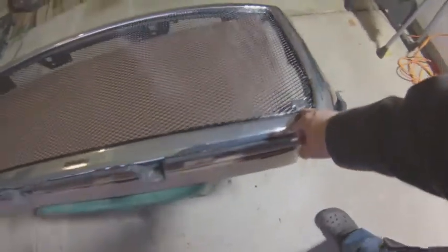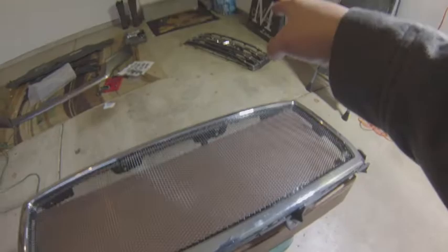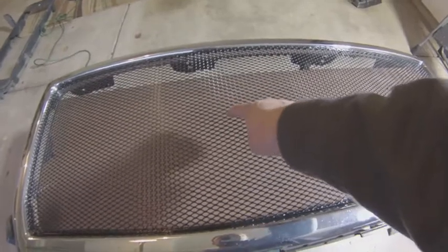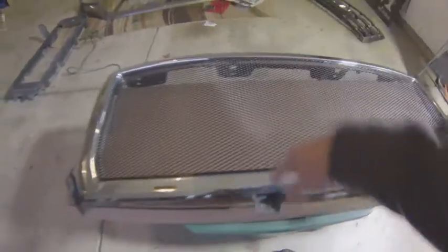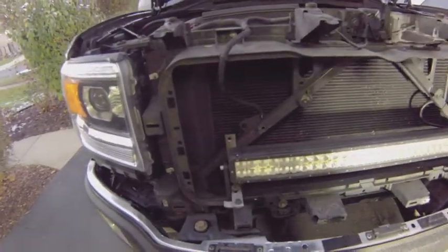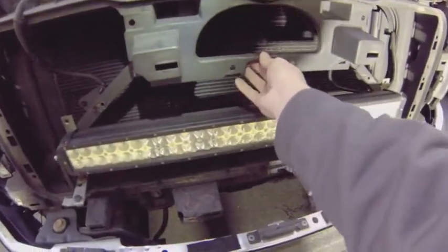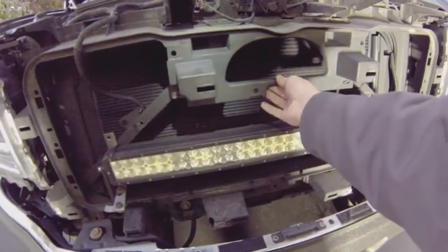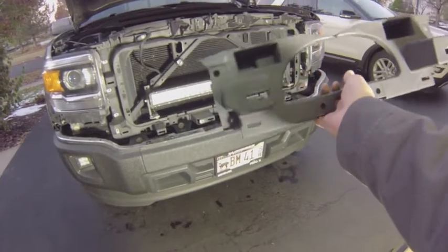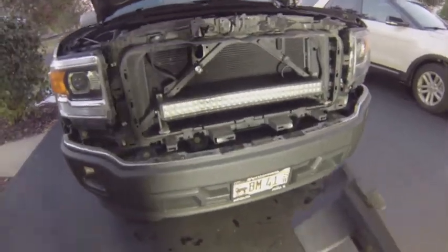You've got the little Grillcraft emblem on there. My ultimate goal is to take the emblem off the stock grill and get it mounted on here by trimming down the flat tabs and using the alignment pins with screws on the back — that'll hold it pretty flush. Now, the instructions say it's optional to cut off that plastic piece in the back, but I almost think it's mandatory because it really does clean up the look. Since you're already past the point of no return with the grill, it's definitely worth cutting off that top plastic piece for a clean finished look.